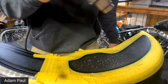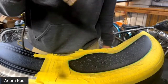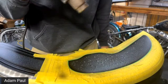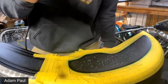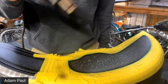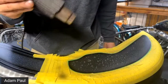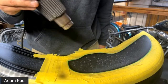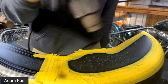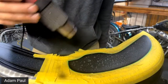If the only option you have is a 0.35, I mean, that's fine. I'm just saying a lot of people's problem is the fact that their airbrush gets clogged up because they're inexperienced with how much to reduce and stuff like that, or how to fix it, or maybe their airbrush is a little dirty or something like that. But having the smaller nozzle is going to cause more clog ups, and more clog ups means more frustration because it's just hard to deal with sometimes. Let's say if you start with a 0.5 needle and nozzle in your airbrush, probably do that, because I feel like you just have an easier time, but who knows?